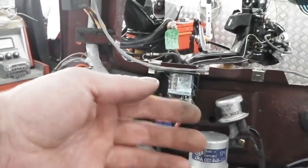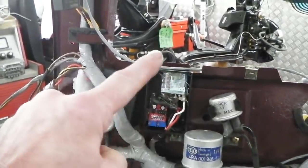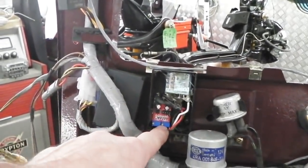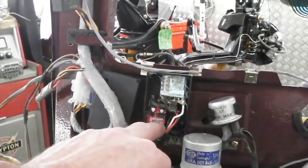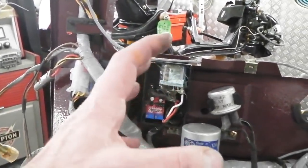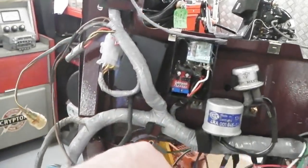Anyway, we're using it as a click output, a 12 volt output. That's all that is. It's 12, 12, 12, off on 12. And you can adjust the rate with those little screws so it can make a really fast hazard light flash. Then all it does is it drives this relay here, and then separate, completely separate wires, nothing to do with the flasher now, into the contacts, come out here.